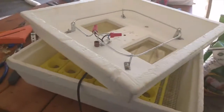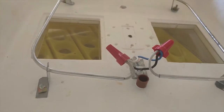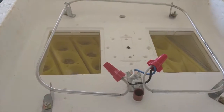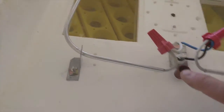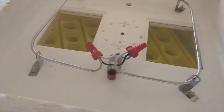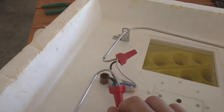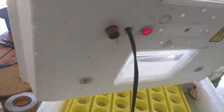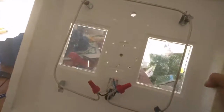Let's take a look at where we're at now — we've made a good bit of progress on the electrical side, and like I said this is the easiest wiring gig you're ever going to do. You've got the mains coming in — those are the black wires. The white wires go to the heating element, which is a resistance-based element with a really thin coiled wire that just gets hot. Then the blue and white wires are for our indicator light. While it's plugged in we're generating heat. Now we're going to start pimping out the feature sets.